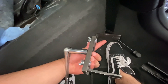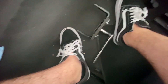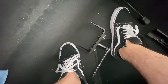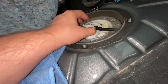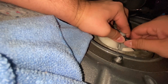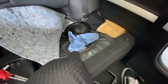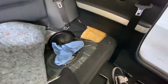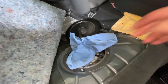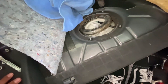I had to go buy a proper spanner tool to unlock it because hammering was destroying the little tabs. Hopefully this one fits — it's the only one they had. To get this off, you push the tool in, the tabs engage, then you pull out. I'll do that now. You don't want fuel to spray everywhere; since I had to drive it, there was a lot of fuel pressure still built up. I'll clean that up with a rag and then start taking off the hose.